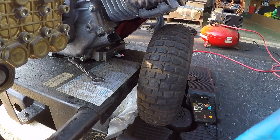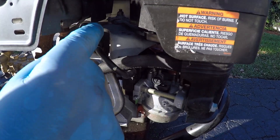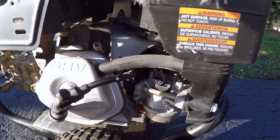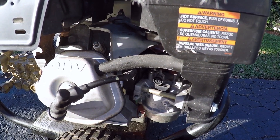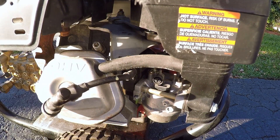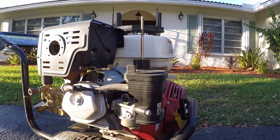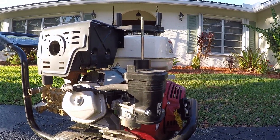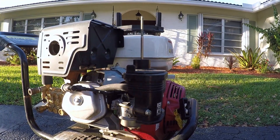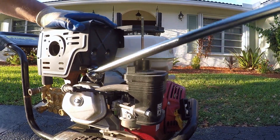Obviously I'm not going to put the oil in yet — I'm going to take the spark plug out first, then put the oil in. Don't forget not to put the oil in your machine beforehand. There's a spark plug right here — take this little cover out, boom, spark plug's underneath. I think I changed it about a year ago but it came with the kit, so why not do it all. We need a 13/16th socket. I didn't have an extension so I have a breaker bar — I had to take off the air filter and take the bottom piece out to get in there.